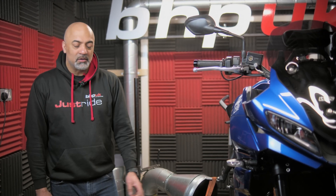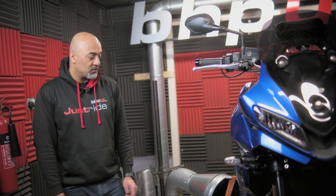Hi, Cal BHP UK. We're continuing with the development of our Triumph Euro 5 bike range on the dyno. Today we have the Triumph Tiger 660 inline triple, which shares exactly the same engine as the Trident. I'm led to believe the base engine is also the same on the new Daytona with some revisions. What we're going to do is run it up on the dyno, take some base readings, log some extra parameters, and come up with a tuning strategy to make it feel properly and run right.